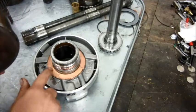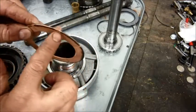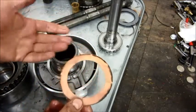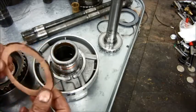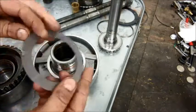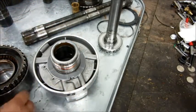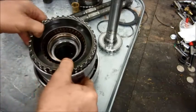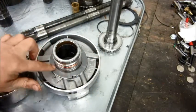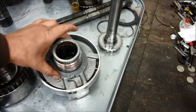Another thing that can go wrong in the 440 is this plastic thrust washer — you can see the burning around the edge already where it was running at high speed under pressure. If that breaks and falls apart, you get so much end clearance that the rest of the transmission will be destroyed quickly. GM has a better idea: the 4T65E has one made of steel with the same exact dimensions and it takes the same position. Put it in there and you eliminate that failure point. I'll change these bushings out and use this steel thrust washer, and that will help the durability of the second clutch and prevent failures of the whole transmission.